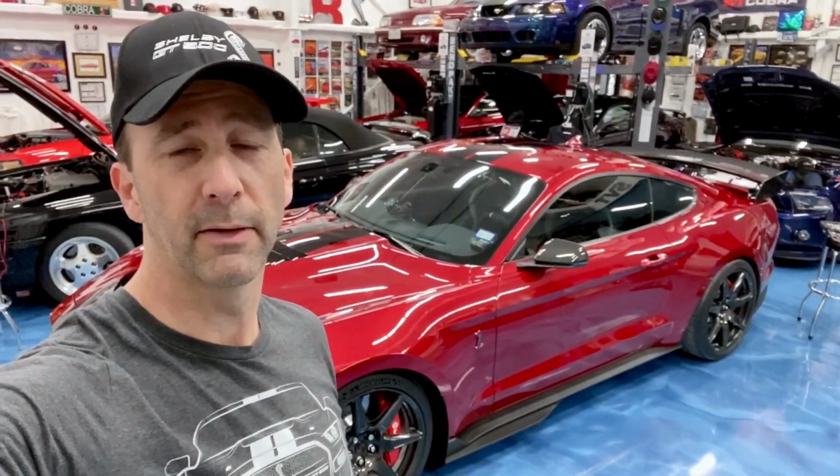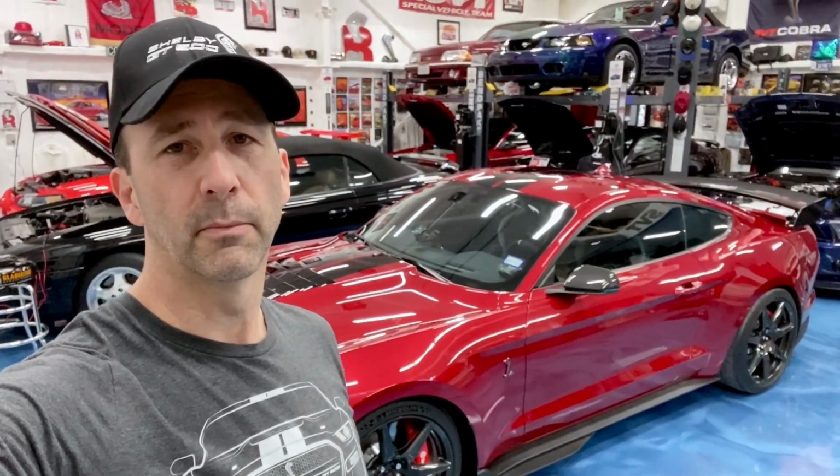Well, that's it. Just a quick trunk realignment to keep the paint from getting rubbed off on the corner. You can lift from the middle, but that obviously causes problems with that glossy rear panel. I like to lift from the edge there, but that was causing the trunk to rub. So make sure you check your cars, and thanks for watching.